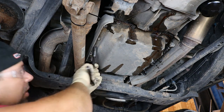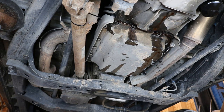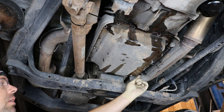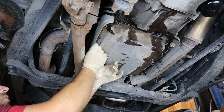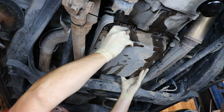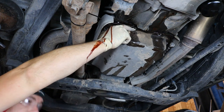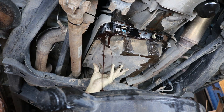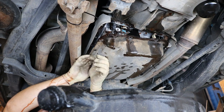I'm just working the pan with a screwdriver, prying it down once the bolts are loosened, because sometimes the pan will stick. I'm slowly working it, trying to get the fluid to drain out at a reasonable rate without making a huge mess. Right about here is where I finally get the pan to dip over. Normally you can lower the whole pan down without dipping any of the sides to keep the fluid in it, but because of the way the shift cable is on Colorados — and presumably Silverados and other trucks — you can't do that.